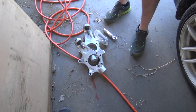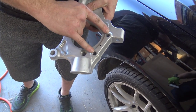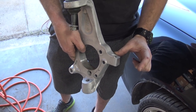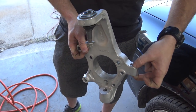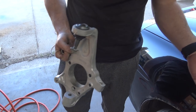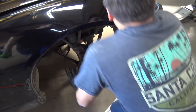So these knuckles are the same as those up front. And when you look at this one, if you're utilizing this in the rear, this is for your emergency brake. What we did with the factory one, so you could not use this in the rear anymore, is the factory pickup point's out really long. So we shortened it up, and by shortening it up, we're increasing how much travel this has, because we're moving more towards the center access point. That's pretty simple too. Yeah, it's very simple, and essentially we want people out there in these cars. So yeah, that's pretty rad.